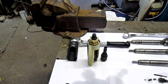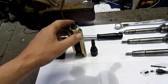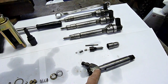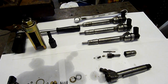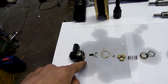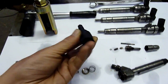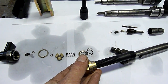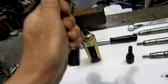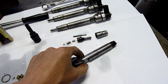Not incredibly bad — no real black smoke or anything — but one of the injectors is just weeping out the tip, and I'm getting a lot of incomplete combustion. That's a tool for removing them; I haven't had to use it properly yet. I got lucky when I pulled the fifth cylinder injector out — I was just able to wiggle it back and forth and sort of push up on it with a screwdriver and it popped out. A lot of the time you have to take all of this out, take this part of the tool set, remove that inner piece, unscrew that, then screw that down inside the injector body with this on top and tighten this nut down and jack the thing out. It's a fairly extensive procedure for removing one that's fully black deathed into place.